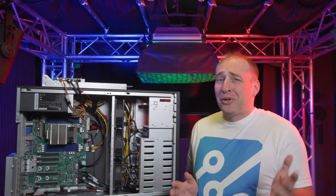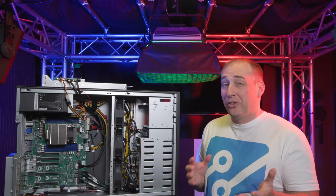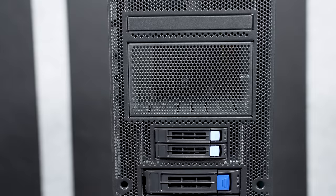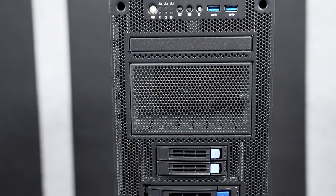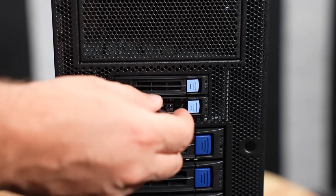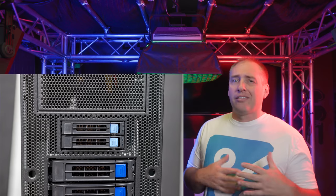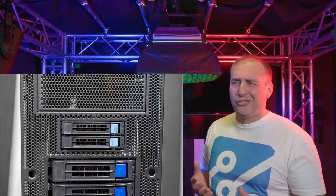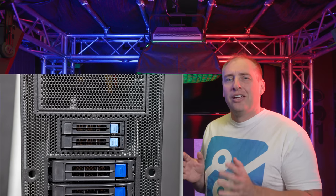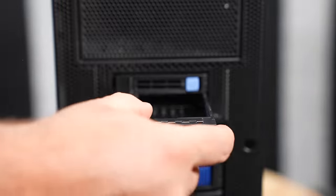Something that is a little bit fun in the server, just because we don't see that many servers with these anymore, is that we actually do have an optical disk drive bay. We also have what looks like basically an eight-bay, two-and-a-half-inch drive bay system that doesn't have a backplane connected — there's a blank in front of it. It looks like maybe there was a spot for a different model, maybe with eight more drives, but our model does not have that feature. Below that, we have two two-and-a-half-inch drive bays, which are awesome. These can be either SATA or NVMe, and you could also potentially put a SAS controller in there. Most likely folks are going to use this as two-and-a-half-inch U.2 NVMe or SATA storage. Toolless hot-swap carriers are included, which is nice.